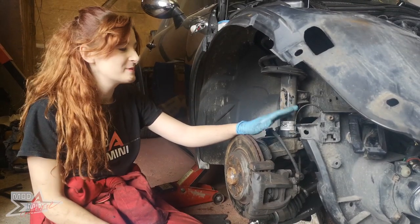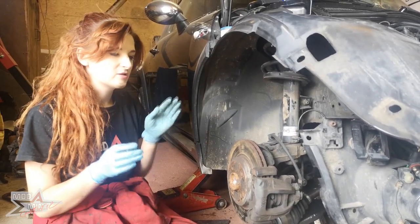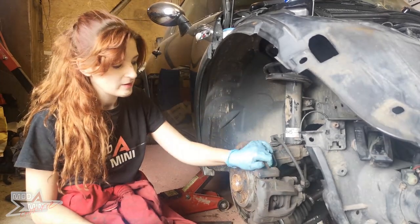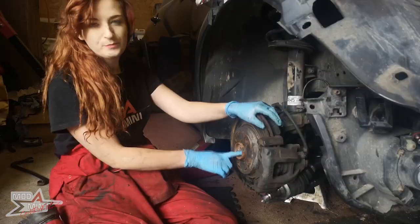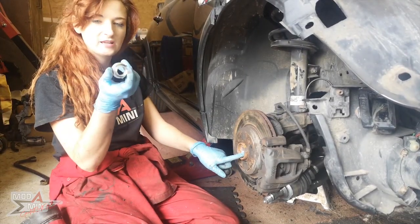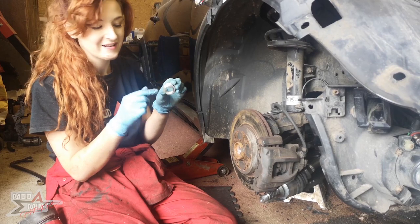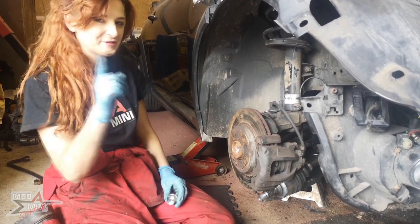So the three bolts are back up. I also took off the power steering fan in the end because that gave me significantly more room for the two that are on top of each other. The next job is to play around with the hub until the driveshaft is back through this centre hole. Once that is through the centre hole, you can put the new bolt back on.